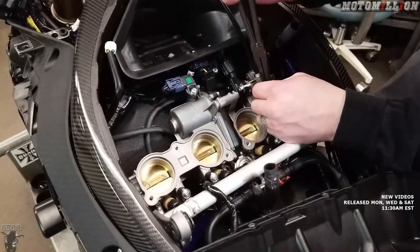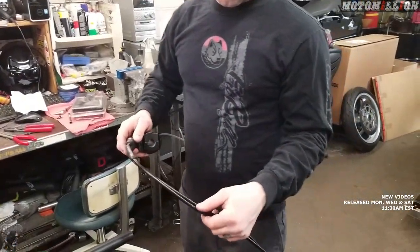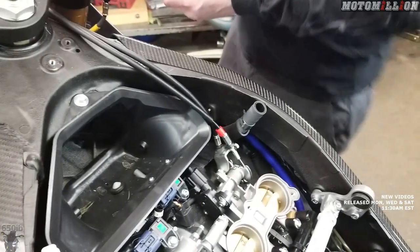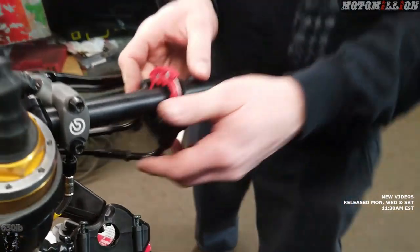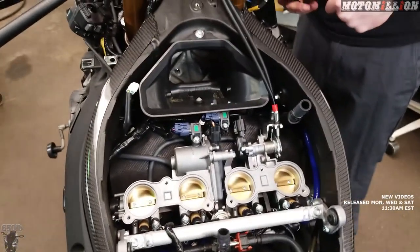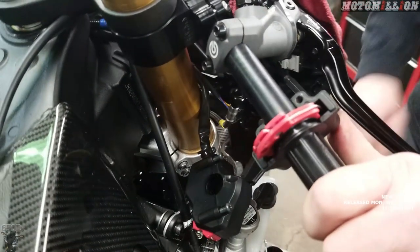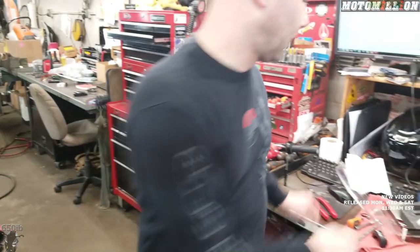Always got to have patience when dealing with cables — if not you will break them. That should release our throttle assembly housing. The factory has some pretty good pinch points. The red ring winds up on top, which matters because there's a screw that holds the bracket keeping both cables in place — that has to be on the right side. Once hooked up you can see it's back to moving. I noticed this large ramp on the red piece — that's part of what makes it pick the throttle up faster. The green one has no ramp on either side, putting the least stress on the cable.